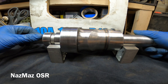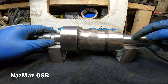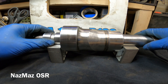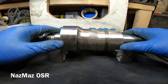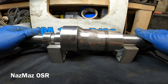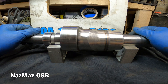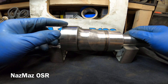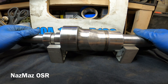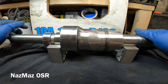So there we go, fellas — the center shaft is nice and straight, nice and clean. In a few more days I'm gonna send it to Mazatrix so they can polish up the center shaft. It does have some grooves on here, but that's something Mazatrix can take care of. They're also gonna go ahead and balance the whole rotating assembly — I want this 10A to last as long as it can. If you guys enjoyed this video, give it a thumbs up, subscribe if you haven't, and if you got any comments or a different method, let us know in the comments below. Thanks for watching!